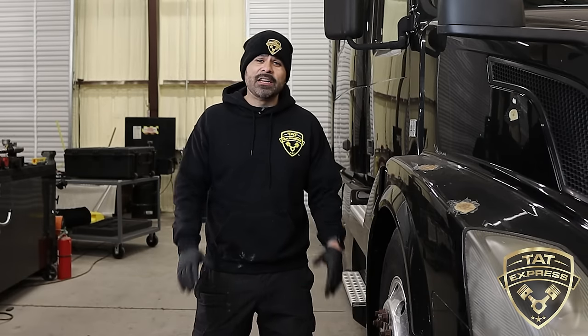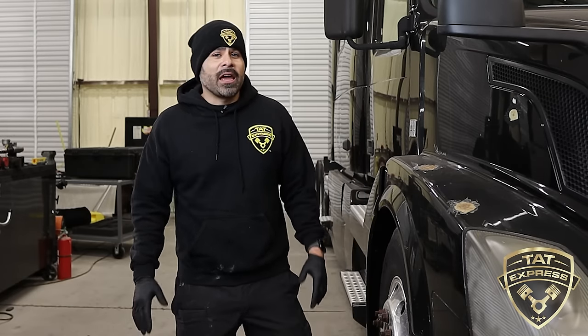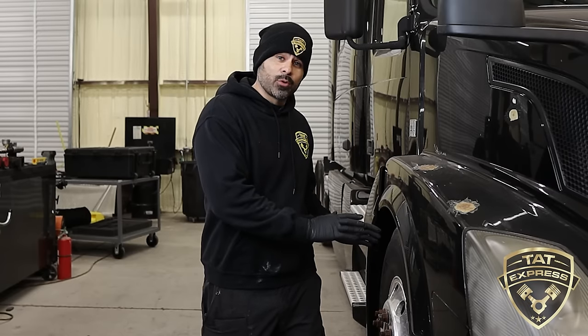When I first started in the industry, a buddy of mine had a truck shop, and in that truck shop, they also parked in the back. One day we showed up and a truck driver accidentally ran himself over. The reason why I wanna share this story with you is because he was attempting to adjust the brakes on his truck. Now what he did is he released his truck brakes, but had his trailer brakes set and the trailer was loaded. Now this wasn't enough for the truck not to roll. So when he actually adjusted the brakes, the truck rolled and accidentally ran over himself.